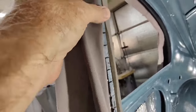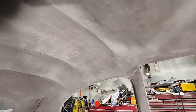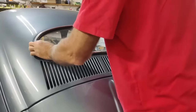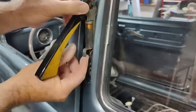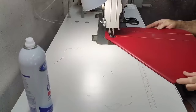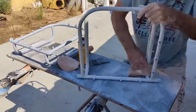I did my own headliner. It came with the car — he'd had it inside the car for years, and I was worried the wrinkles weren't going to look good, but it came out really nice. The magic is the steamer — you steam it and really spend your time steaming it at the end, and it just stretches right out. Then put the glass in and all the trim. I also made the glove box out of paper mache — it can be painted. They make an ABS reproduction glove box but I wanted something at least similar to the original material.